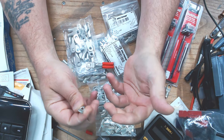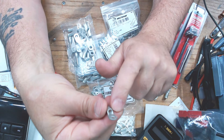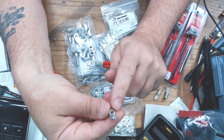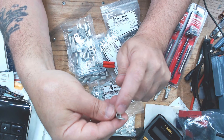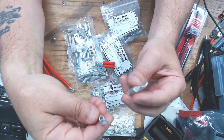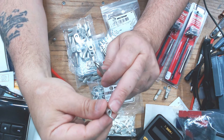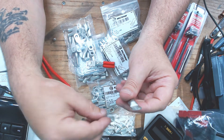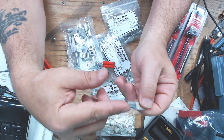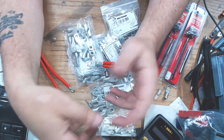These open-ended lugs are okay, but since this is located inside the track drive where moisture can get in, the closed-end lugs are preferred for our application. Moisture can wick right in through open ends onto the wires. Also, closed lugs have a larger cross-sectional area for current capacity — you'll fry the entire electrical system before you come close to damaging these lugs.